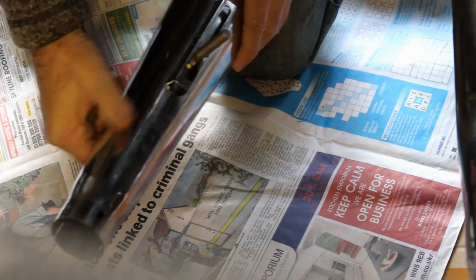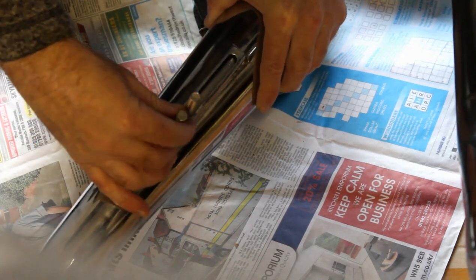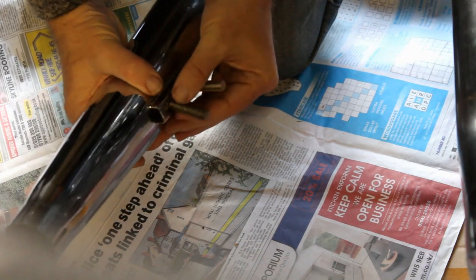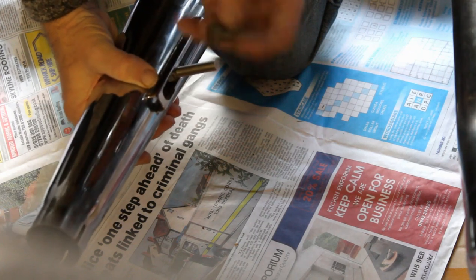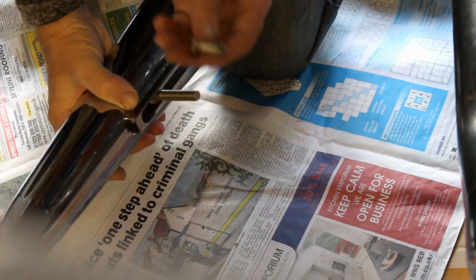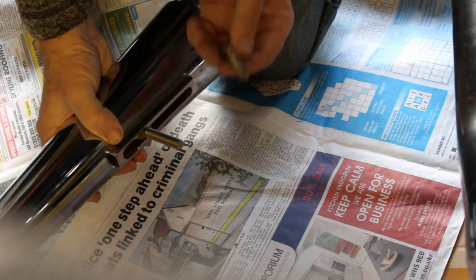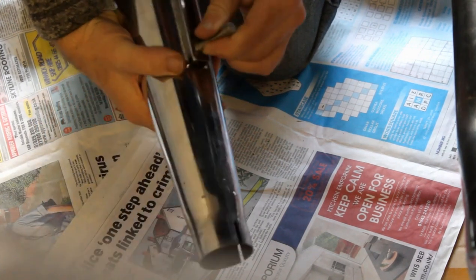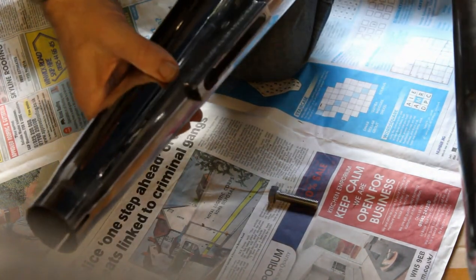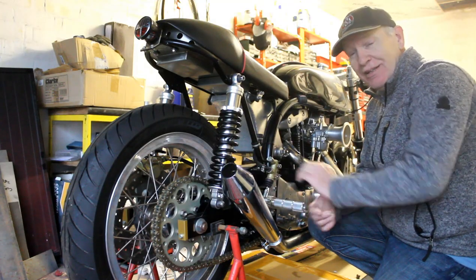The reason I've been filing down the head of this stainless steel bolt is so it will slide into the mount of this silencer. The mark one version is a little shorter — about three to four millimetres — and it only just engaged with the nylock nut that held it in place, so it wasn't ideal. I've known about it for a while but it's so boring to do. Now it can go back on the bike and hopefully it'll stay there.